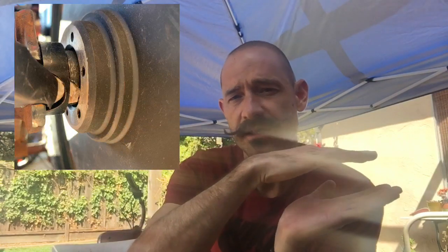I did go back and start looking at everything, and what I think might have happened was when I installed the wheel, the angle that this big thick group of wires comes out through the axle or through the motor and then has to work its way through my dropouts might have been too severe. And the horizontal dropouts that I had cut were pretty sharp and extended pretty far out. So I think the combination of the angle with the wires, it might have dug into and shorted it out.